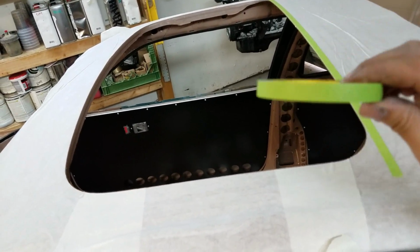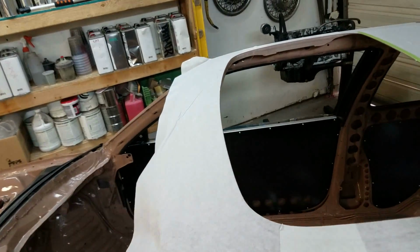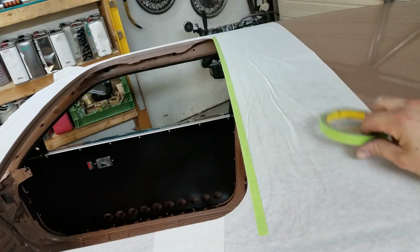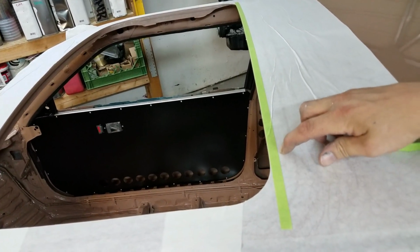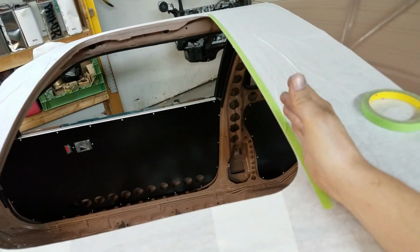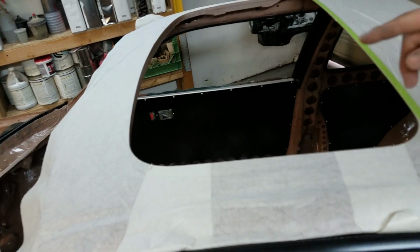So, I have half inch tape. This back side is a straight line, and the front side is not. It has a curve to it like this. So what I did with the half inch tape is I ran a nice straight line flush up against here. Now I'm gonna line my aluminum up to this edge, so I know that I'm a half inch over. And then from there, I'll just mark my line all the way around.